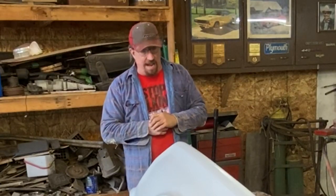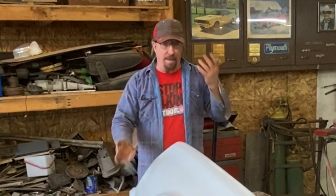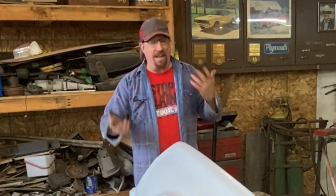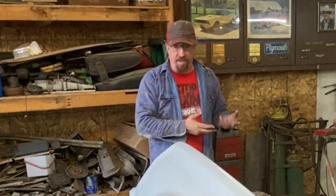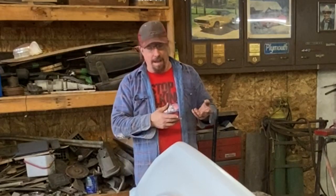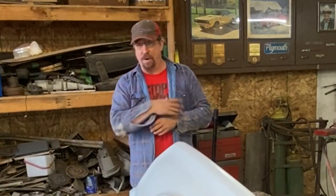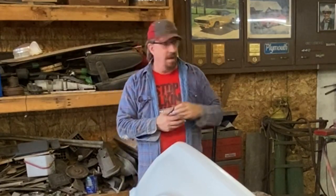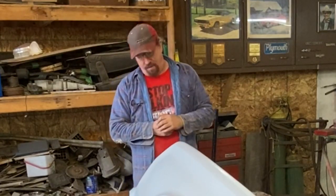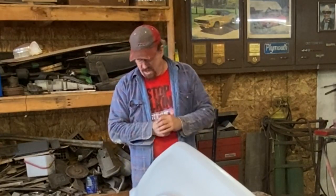Now you can spray this on there. It kind of is a crossover between the skim coating with Bondo and all of the flattening we used to do in lacquer primer. And it's way cheaper than the urethane primers and so forth. Excuse me, I've had this quart a while. Whew, solvents are strong. I think I paid $30 for it, maybe. And I know I used some on the '47 out of that quart, and there's still at least a half a quart left. So we're going to have plenty to finish this fender. Like I said, it's looking good. I'm pleased with it.